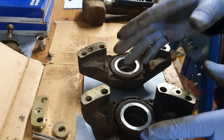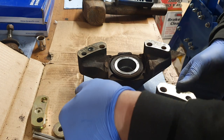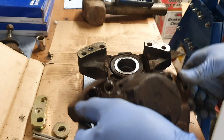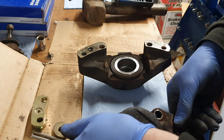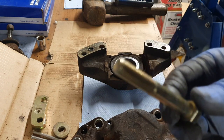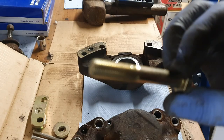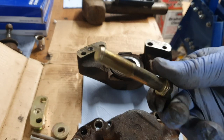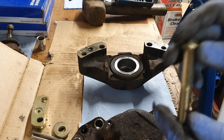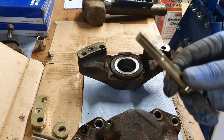It's now a really nice simple task of literally just bolting them back together. I recommend always putting a little dab of thread lock on every single one of the bolts, because then they're definitely staying in tight and they're not coming out. And again, it's brakes — safety — you don't want them coming loose.